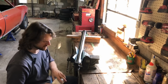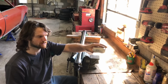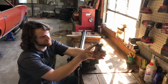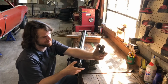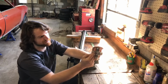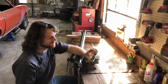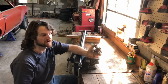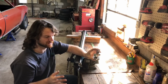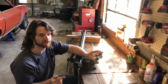And so to convert all this together, I use this U-joint here. Part number on this particular one is a 372. And here is that. As you can see, it's a staggered U-joint. We got the big length here and the big caps to go into the drive shaft, which is the S44 3R. And then we have the narrow small cap that goes to the factory Vega rear end, which is the 1310. This is actually, believe it or not, a factory part on some cars. These U-joints were used on some late 50s and early 60s Oldsmobiles and 1988, I believe, to 1992 F-bodies.